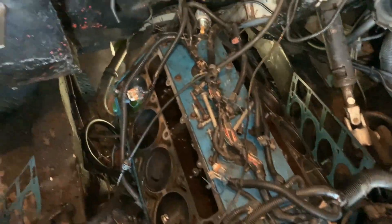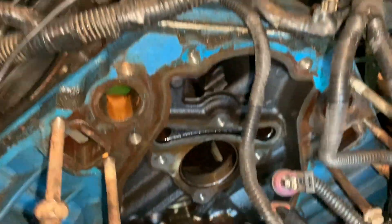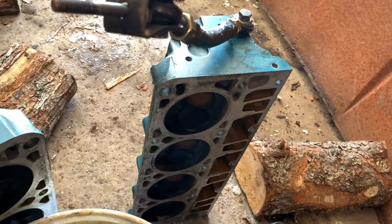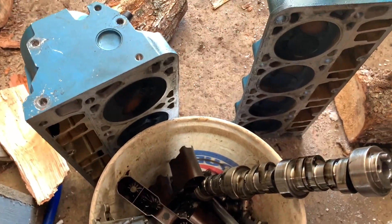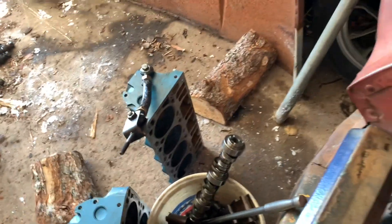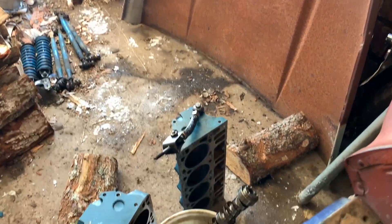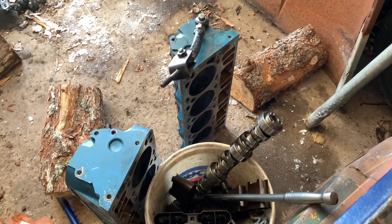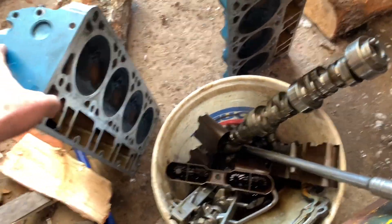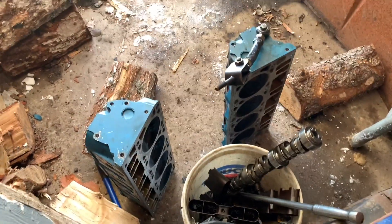I went ahead because the camera died. I got the heads off, camera's out, lifters all look good — no damage to the heads at all that I can see. I'll get a light on it later at the shop. The cam looks really good. This is an LS6 cam, which is 550 lift, and it's going to make a big difference in the 6-litre because it was 460 lift. These heads also have LS6 springs and LS6 pushrods, and I have LS7 lifters in it.